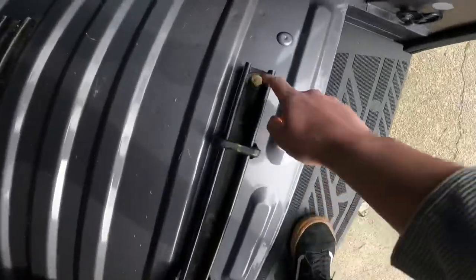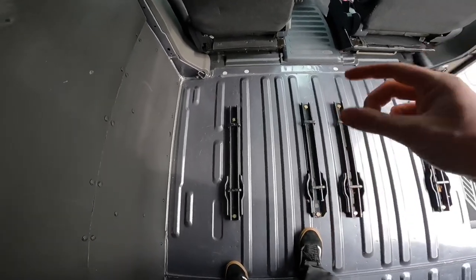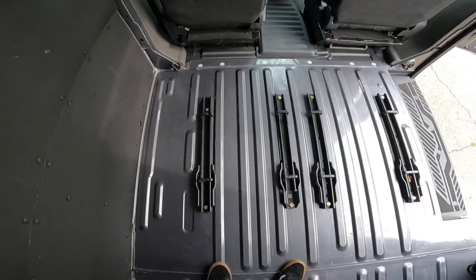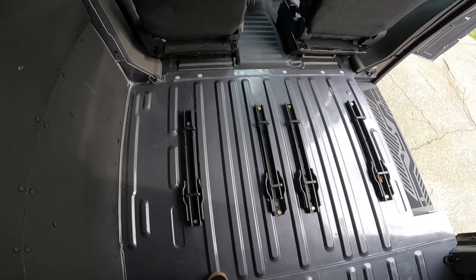This sucks right up to the bottom of your van, prevents rust, and creates a good seal. Throw your brackets down, throw all your hardware, and have someone underneath the van with those steel plates — nut welded on top, have them hold it, and you just sit here with your gun and drive it in. Now that you have your brackets in, go ahead and attach your seats.